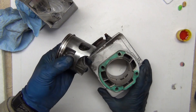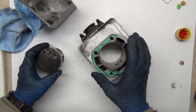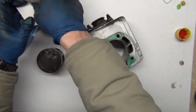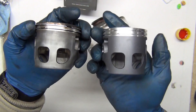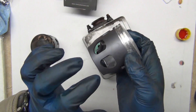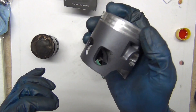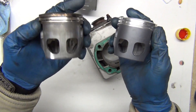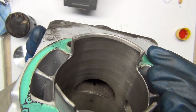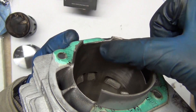If you replace your piston before it fails and causes real damage, your cylinder will last a lot longer. Cylinders on a dirt bike can be as much as $1,500, or a new cylinder for this is about $500–$600. The piston is about $250. If I had replaced this piston earlier I'd have been better off. You can see there's a little alignment pin where the piston ring ends meet. Looking at the scoring here — none of it is very deep, it's pretty superficial — but comparing old vs. new piston, the worst scoring is usually at the exhaust side.